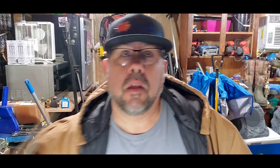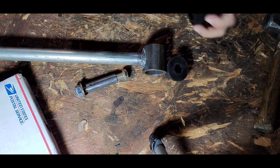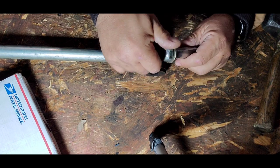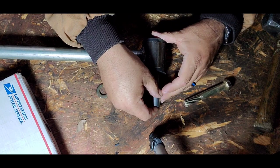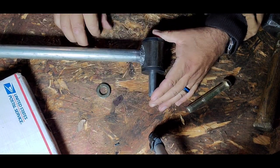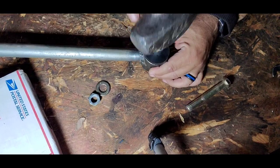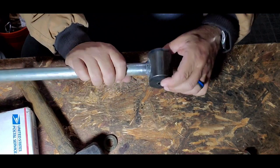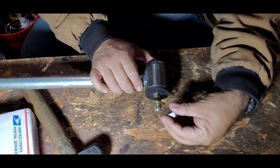Bushings. Hardware. Alright, this is how easy this is. If you've done suspensions before — any type of suspension — and you've changed up your bushings, this is how easy it is to put together. Then you're going to take this. Some people would suggest putting silicone grease in this, which we probably need to, but for now we're going to show how this is done and we can put that in later. Put it in there so it's flat, and then you throw your bolt through there. That's just to get these ready.